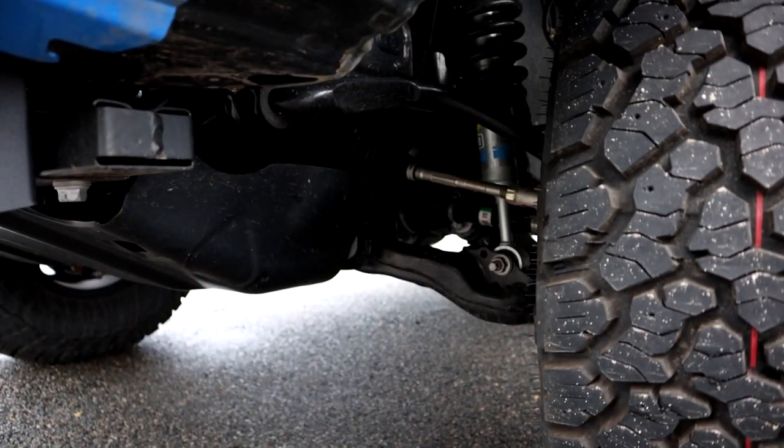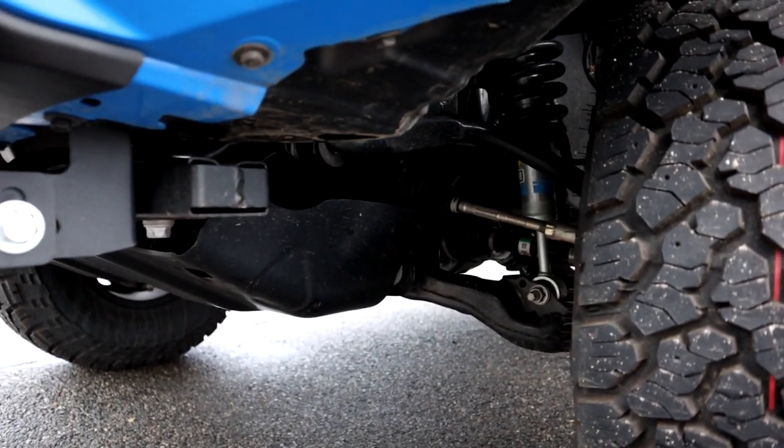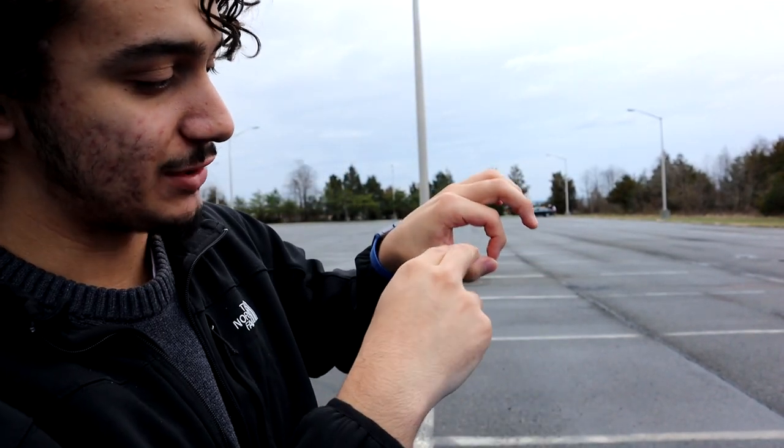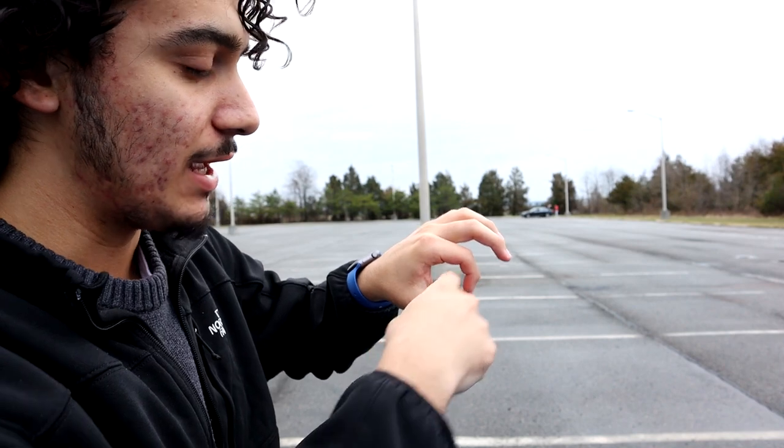Where there's a will there's a way — he told me to bring it in. He takes off the tire and starts looking at the seal. The seal was placed in there properly from their knowledge, but here's where it gets tricky: the seal does not need to go all the way in. Inside the Tacoma where the bushing goes, there's a groove that is thicker on the outer edge than it is further inside. If you slam the seal all the way in, oil leaks. So what they did was move the seal a little bit further out so it could sit right on that outer liner — and no more oil gets out.